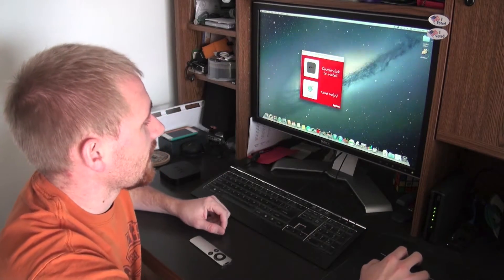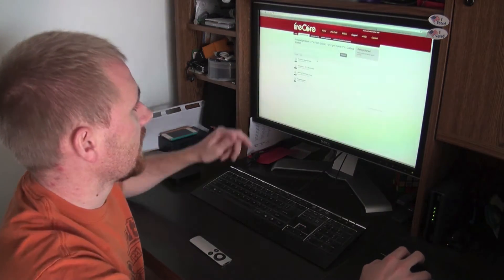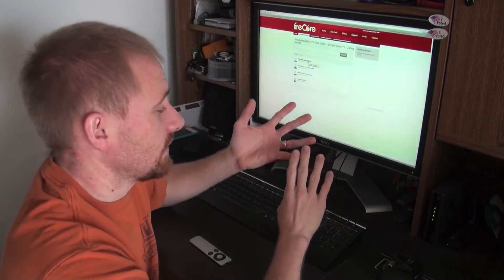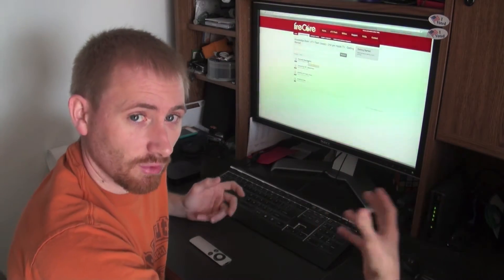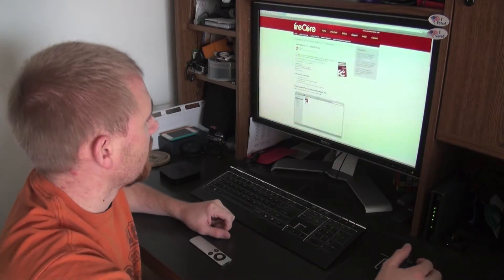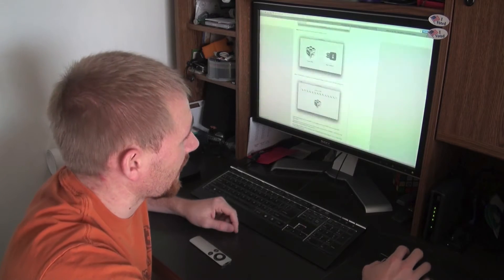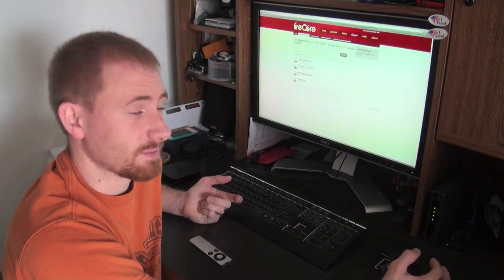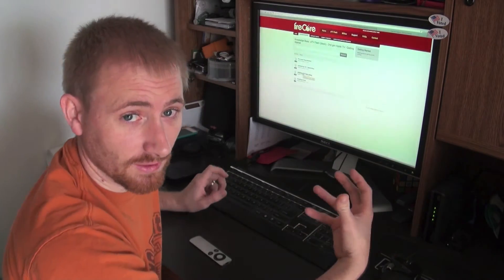So the first step is actually jailbreaking it. Within the downloaded file there's an install guide that goes over the pre-installation requirements — an updated version of iTunes, the latest updated Apple TV 2 firmware, and of course the jailbreak you'll have to do prior to installing ATV Flash. Jailbreaking with Season Pass — there's a nice install guide that goes through the entire process. I've only done it once before, quite a while ago, so it's probably been updated a bit. The nice thing is it's untethered; you connect to your network and it does it all through iTunes via home sharing.